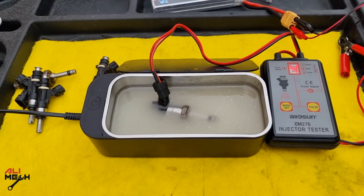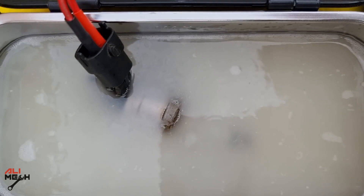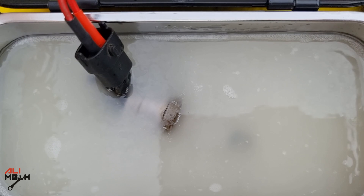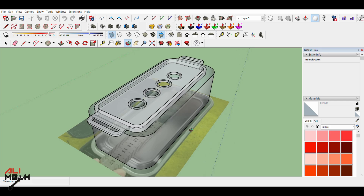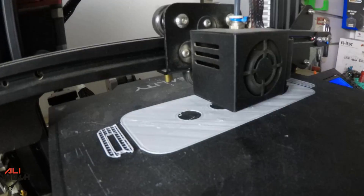As you can see in my last video, the fuel injectors are touching the bottom of the cleaner vat, which can damage the ultrasonic cleaner if it were more powerful. Since it's 42 kilohertz it's not a big deal, but that's why higher-hertz ultrasonic cleaners come with a cleaning basket. There's another benefit too: if the injectors are vertical, the waves only hit the tip and break any stuck particles.